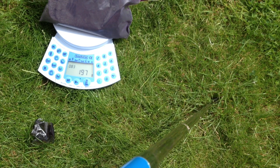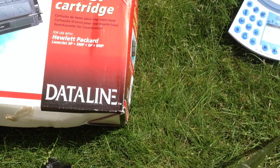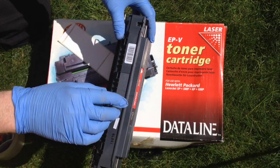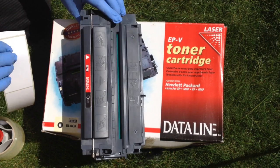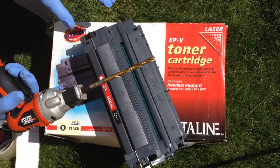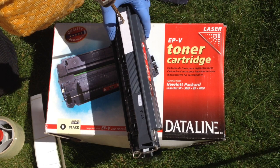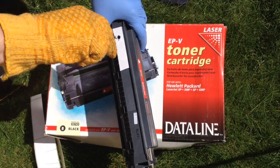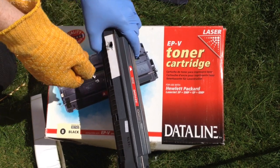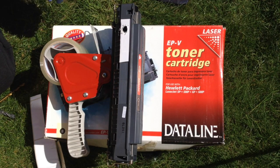Now what I need to do is cut a bigger hole in the other HP cartridge and get the toner in. It looks like this technique will work for the HP LaserJet 5p, 5mp, 6p, and 6mp. First thing I'm going to do is stick some paper across here — it's easier to stick to paper afterwards than to the plastic. Extremely sticky label. Now I need to drill a hole: start with a small drill and then open it up manually with a much larger drill. There's the standard size hole, and I'm going to open it up manually with this larger drill. I'll try not to drop any bits inside. Luckily it's quite soft plastic, so we have a nice large hole in place. Now I'll cut the corner off my bag.